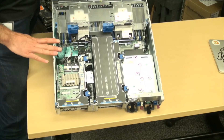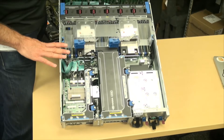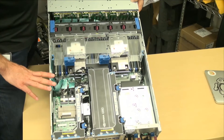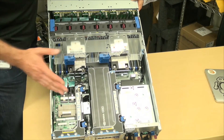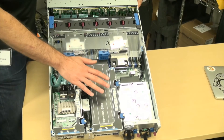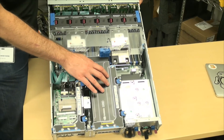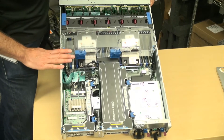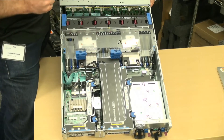So this one's got plenty of space for expansion both in the disks in the front as well as in the RAM, depending upon the workload. Customers configure that depending on what they need. Particularly with the GRID card in here, you're looking at a high-performance VDI desktop, and so you're probably going to saturate CPU relatively fast on this one — and that's why there's the 10-gig in there, because this is the VDI build.